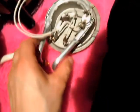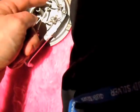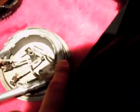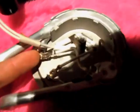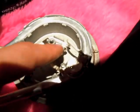We have all the ingredients here for a hot plate with a safety thermostat — the input wire goes through this thermostat, then into one end of the heating element, and back out the other wire. So you could just feed water through the tube by any means necessary and get a nice hot water heater.